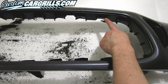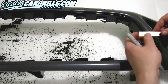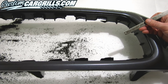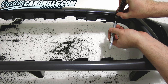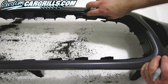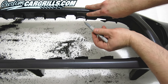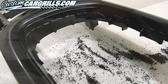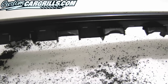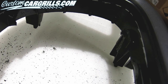Next, I want to find a common maximum distance from the old plastic bar to the edge of the unpainted grill center. In this case, the upper corners are the most shallow — they're about half inch from the top of the unpainted area. I'm going to make a couple dots where that is with a silver marker, then connect up the dots, and we'll have a nice clean line where one half inch from the top is. I repeated this step around the whole inside of the opening, and now there's a solid guide on where to make the next cuts. Using a half inch painter's tape instead of the marker would also work really well for this step.